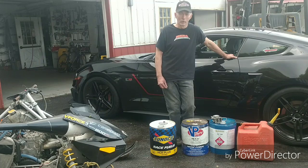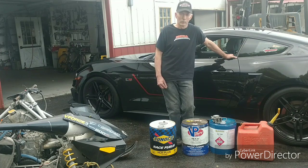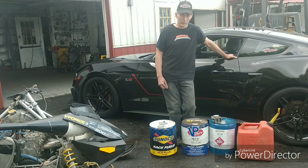Another complete misconception — you see all these guys, especially on the 850, trying to tune customers with a 180 horsepower ported machine debating a resistor for more fuel or no resistor. The resistors on Ski-Doos might give you one percent — very little. So if you take a 166 horse machine and make 14 more horse, you're going to need a PC5. Realistically, a port job is going to give you four or five horsepower. The easy way to verify any claims: if a guy says he's going to add 20 horse to your sled, ask him for the percent of fuel change.